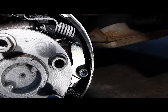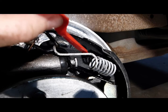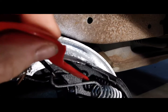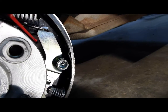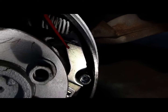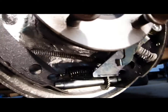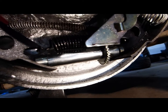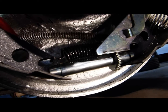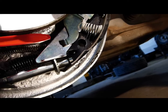The trailing shoe however is plenty busy. It's not only the mounting or pivotal point of the emergency brake lever or bracket which pivots up here. It's hard to see the emergency brake lever because it's behind the shoe, but I'm scraping along the lever or bracket — it's not the anodized adjuster lever. At the bottom of the assembly we can see the emergency brake cable entering through the brake back plate and coming along here, disappearing behind the lever where it attaches to the lower portion of the emergency brake lever.